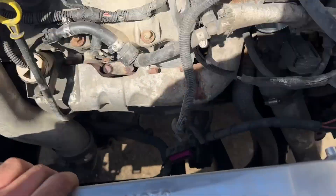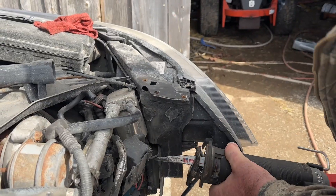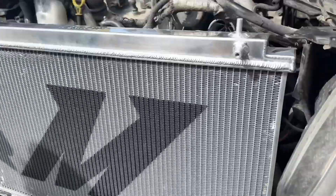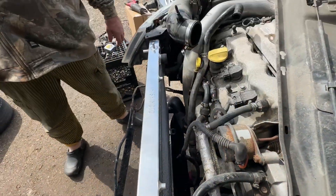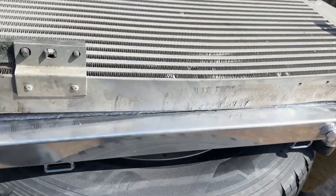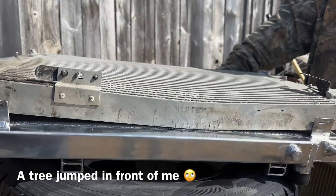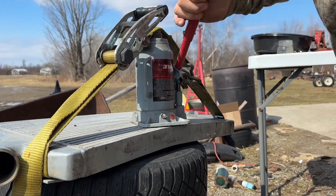Next step is to get rid of the two old top radiator brackets since we may have to weld in a new support up top. We moved the radiator closer to the engine to see if it would fit that way, but it's still too tall and the outflow is still running into the subframe. Before going further, we need to assemble the fans, radiator, and intercooler together to know how much space we need and where exactly to weld the brackets. It turns out the radiator holds the intercooler near perfectly, but I got into a front-end collision and the intercooler is bent.